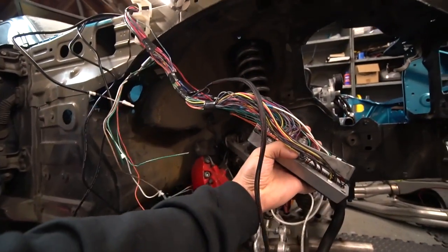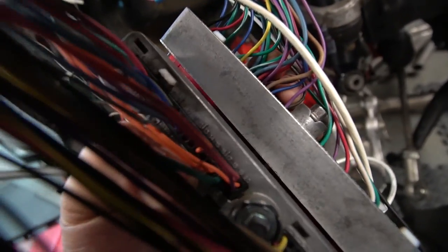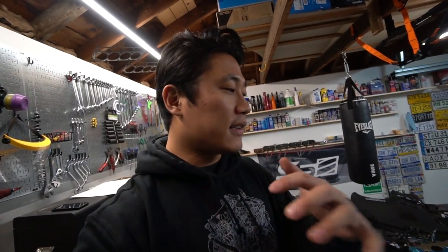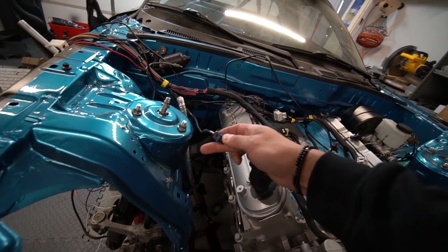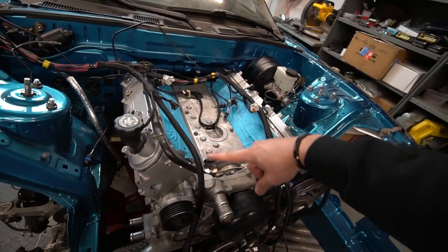I got the engine ECU harnesses — red and blue — this is exactly what you want to follow. There are numbers written right above the cables. So what I'm going to do is quickly show you how the LS engine harness is routed on the engine itself, so you can see how the harness is installed, and then I'm going to take it off and show you exactly which connector goes where. On the passenger side I got the crank position sensor — this is installed near the starter. Next to that is also a water temperature sensor, I'll get into that later.